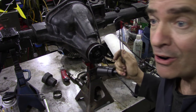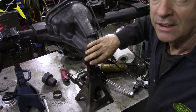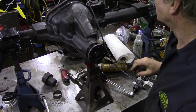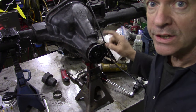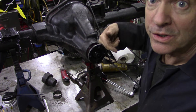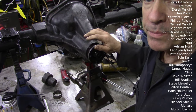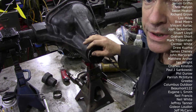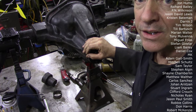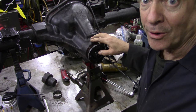The book says three to four Newton metres, but two is just nice — I wouldn't really like to put more tension on it than that. So anyway, that's how to do it. When fitting the seal, remember to put Vaseline on it when you knock it in so you don't knock the spring off. I was lucky on this one because I could knock the seal out from the other side since the diff was out. It's easy to set this up when the diff is out — for you guys at home, getting the diff out is going to be a real pain, so mark it up. If it's got the original flange on the original pinion, mark it up and you should be okay.